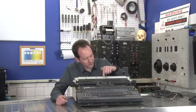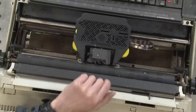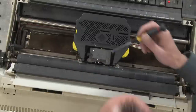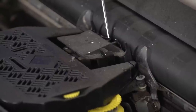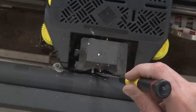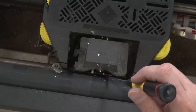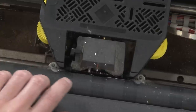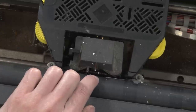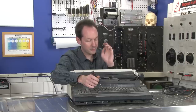So the Daisy Wheel is this part right here. It's kind of hard to see, but the Daisy Wheel is this bit right here, which actually has bits of whiteout stuck to it. But you can see the little petals here. That's the Daisy Wheel. So watch in there, and when I type C, it's really hard to do this upside down. When I type C, you can see this jumps up, spins around to find the petal C, and then punches it forward.